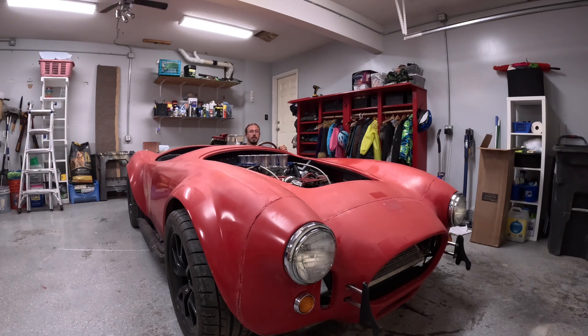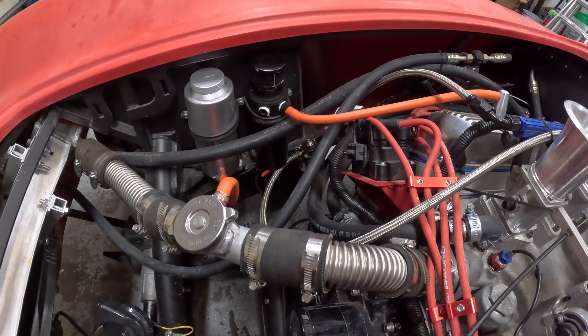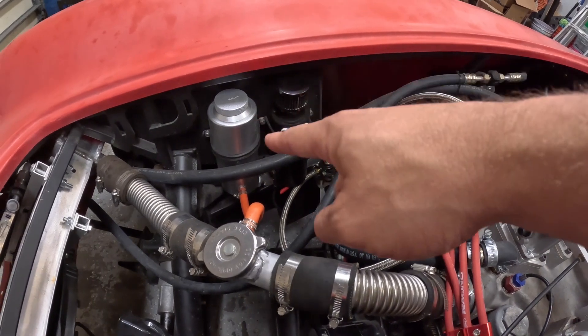Another thing that happened is the headlight switch I had bought — a lower quality one — has broken and burned out. I ordered an ACDelco genuine one to replace it. I've also installed a lower temperature thermostat, now running a 160 instead of a 190, which is probably a better temperature for this engine. I've installed a coolant overflow catch can, and also a breather catch can because I was getting some oil coming out of the breather. So today we're going to start by helicoiling the valve cover bolt holes in the cylinder head.